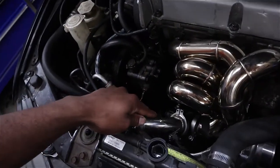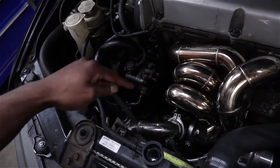Alright guys, so the next step in your turbo journey — whether you just did a custom setup like I did or you got a car that was already boosted — after a while you realize you want to turn up the boost. There are a couple ways you can do that: you can either upgrade your wastegate spring. In my wastegate I have a 10 pound spring, which means that's the minimum amount of boost I can run, or you can go with a boost controller.